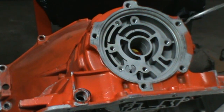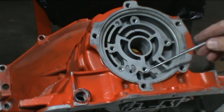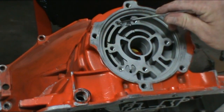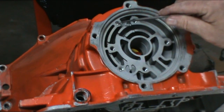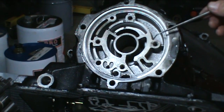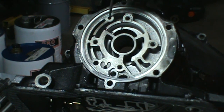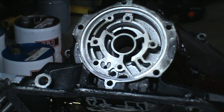Okay, I want to show you the differences between a rear pump model case and a front pump model case. This is a rear pump model — you can see these two ports, one here and one here, that have been blocked off for a trans brake application. Normally these ports would be open, and this would be the reverse supply up at the top here. This is a front pump model — as you can see, it has the same ports, but this one is blocked and isn't opened up. If you look on the inside of the rear pump model case, you'll see the hole that comes into the inside.